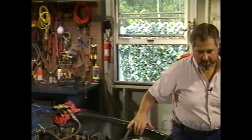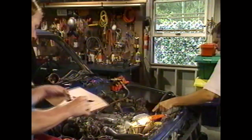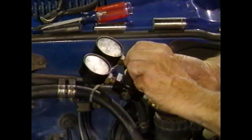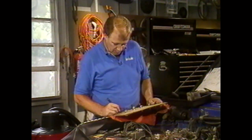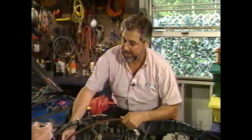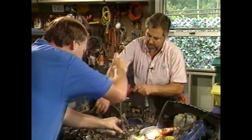We move to number four, the last cylinder, rolling it to top dead center. I'm recording results under each spark plug to keep track. The ignition rotor is exactly 180 degrees opposite when we're at top dead center on number one. We've got 80 over 69 — good, solid. No leak. From the looks of that, we don't have any problem in the cylinders. The problem has to be in the valve seal, because that's the only place the oil can get. This test has proved we have good ring integrity — the oil is going by the valve guides, by the valve stem seals.